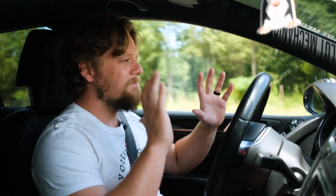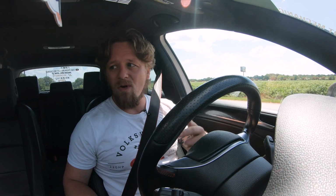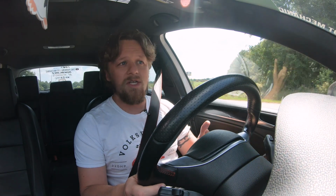the wheels, because it's all math and science and fun stuff. Like, there are superchargers out there that take 200 horsepower just to turn them, but they create 600 horsepower. So it's a gain of 400 horsepower, even though it creates 600, but it takes 200 to turn it. It's kind of similar with this pulley. That pulley on the crank, not on the timing belt, but on the accessory belt, takes a certain number of horsepower to turn it around. Now, if you can reduce how much horsepower it takes to turn that pulley, then that power that's still getting made is going to go somewhere else. It's the conservation of energy, whatever the correct science term for that is. And that other place it's going to go is to the wheels.